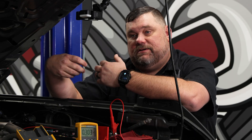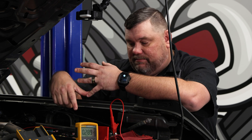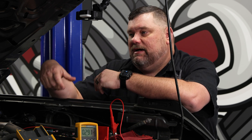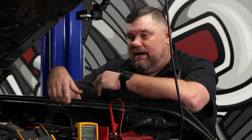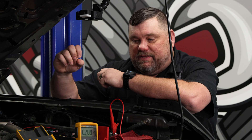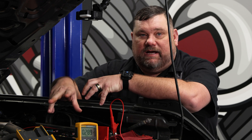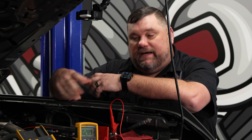We prepped it just like Ford asked us to — we charged the battery, we went on a test drive first, we checked the battery condition. It did need a little bit of charge, so we had it sit on the charger for a little bit. We locked it up, the key is probably more like 100 feet away, and we've let it sit for 90 minutes. So this is a bad test. It's going to take some further diagnosis to actually determine what's wrong, but this is a quick tech tip on how to use your meter to measure parasitic battery drain with your meter in series.